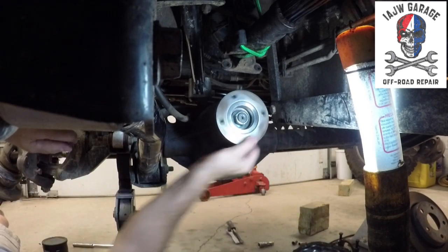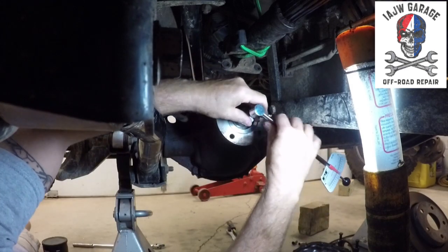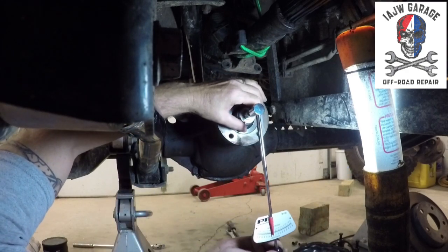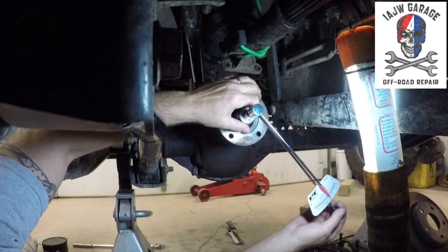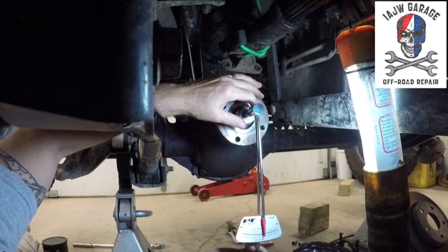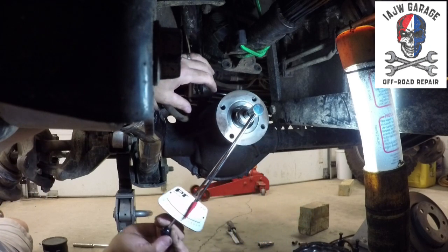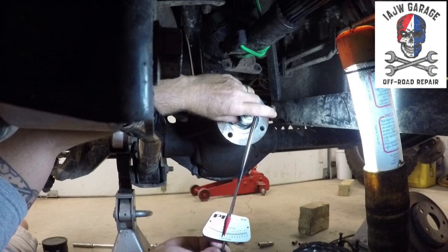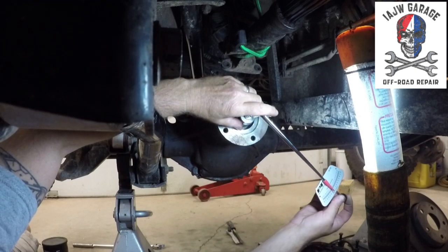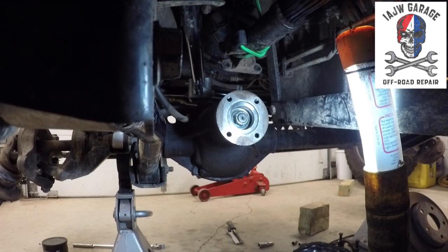So it's got some tension on it. Let's see what it equates up to on inch pounds. That looks like about 16. And that's 14, 16. Hits a spot where it's 18, comes back this way and hits a spot where it's 14, 16. Yeah, it looks to be right around 16, so it's an inch pound over. You know what? I'm good with that.